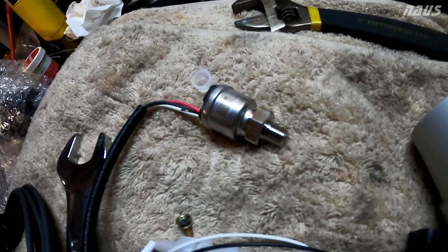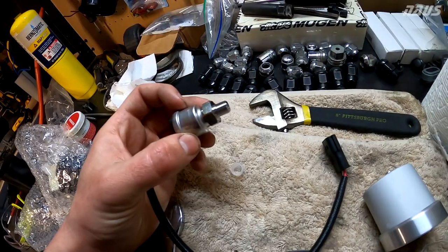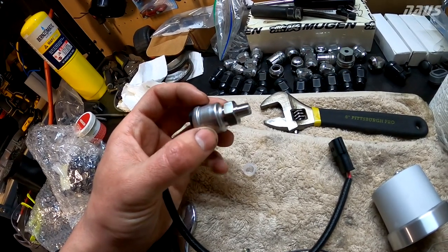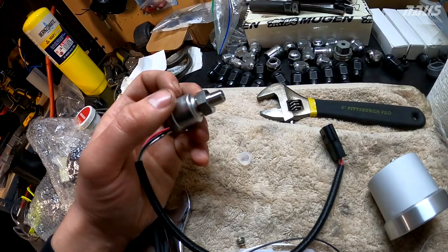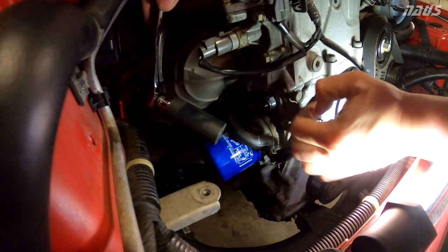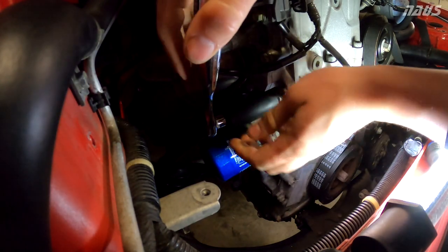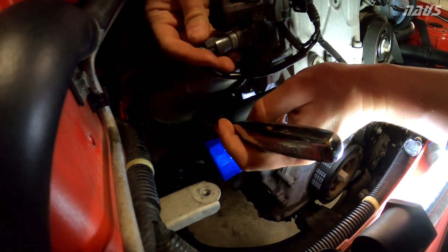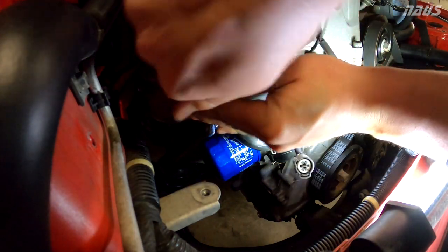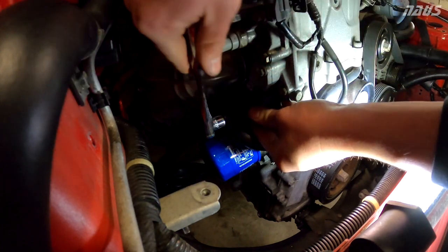You're going to want to use a little Teflon tape over the threads to install the new sensor. Don't put it anywhere near the oil orifice — start it a couple threads up and wrap it in the opposite direction that you're screwing in, so that as you tighten it, the tape wraps continuously on rather than unraveling. Go ahead and get in with your 24-millimeter ratchet and break the OEM sensor loose. I'm going to stuff a rag underneath in case there's some oil in the cavity.